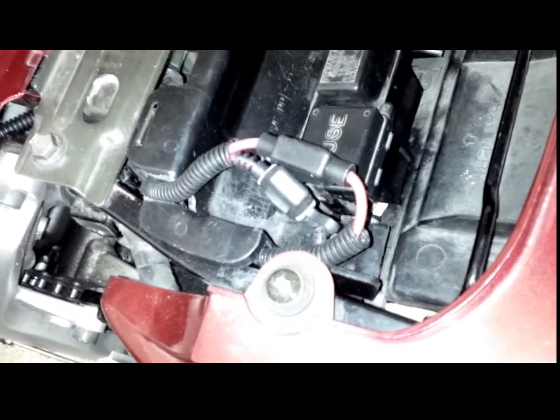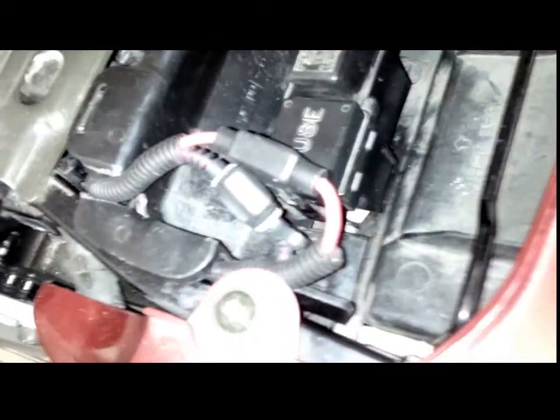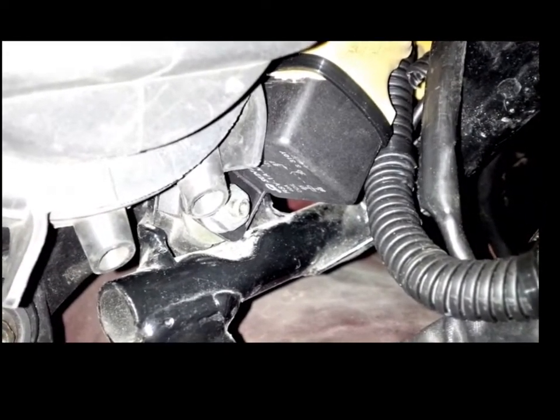So finally got the wiring loom in. The first part of it comes up from the battery here into the fuse box, and then follows a route underneath the tank, following the original wiring harness. You can just see it sticking out there, and then it comes out by the headstock, again following the original wiring harness, and down underneath the fairing and into the relays. Relays live underneath the headlights. Found a nice mounting point on the fairing brackets right here, so that's good.